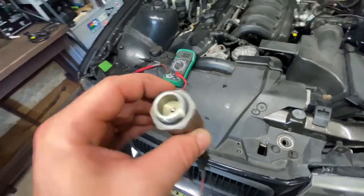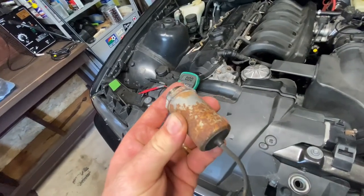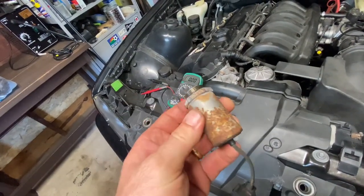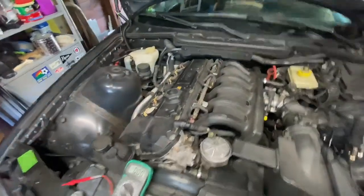When I depress the pedal on the power supply, the little rod pushes forward — and there it goes. If you're holding it, you can feel it's pretty powerful, and as long as power is applied you can't push it back in. The second you release the power, you can reset it. So we know this solenoid is good. I'm going to sand it up, hit it with a coat of paint to look nicer, set it aside to dry, and we'll start tearing this apart.